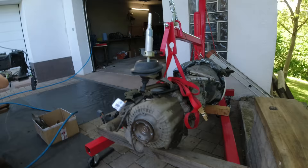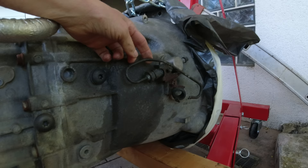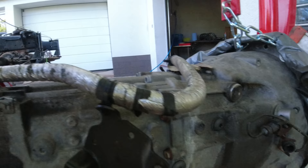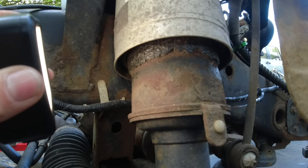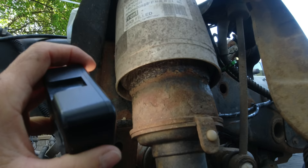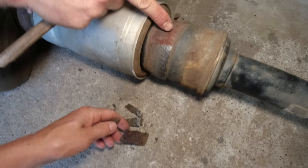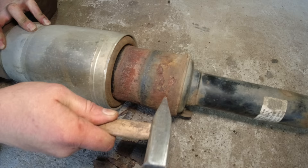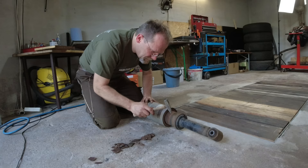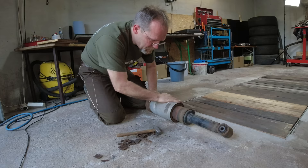Do we need to buy a new one? We already have that piece here — 60 euros. If you can save it, save it. That's kind of true for every part on a Land Rover because the pricing increments are 20, 60, 120 — there's nothing in between. The air hoses look like new. We get a lot of comments saying that this is caked-on mud we can just take off, but somebody also wrote that the stuff on the shocks can be knocked off and they're still good. It can be knocked off, but there's not much material left. It's still corroded — it's not mud. All this came off our front shocks, but it's metal — it rusted away. We bought new ones for 260 euros a piece.